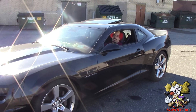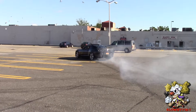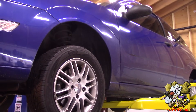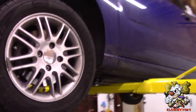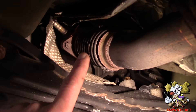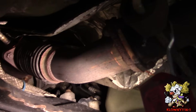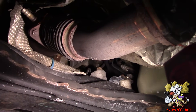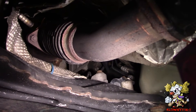Welcome to this town's garage! Hello ladies, in this video I have a first generation Ford Focus. We're doing a flex pipe underneath over here. This is a 2.0 engine and it has a hole and it farts when it's driving. So I'm going to go ahead and change this out — it's from here to here, two flanges, we're going to take the four bolts off. I'm going to do this without a torch, so this is a good video for the DIY guy.